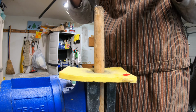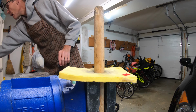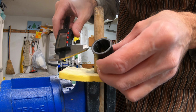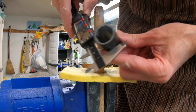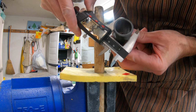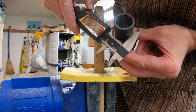I have another experiment design for us. Let's take one of these ones that are fresh, that I didn't break. Let's put a caliper on it, see if we can even register a noticeable outward flex. So if we put the caliper on this right about in the middle, we're about 28.46, 28.49, 28.60. So between 28.45 and 28.6, so about a tenth of a millimeter. Not round.